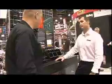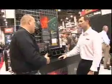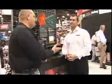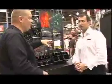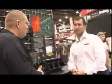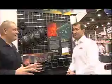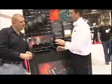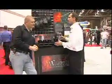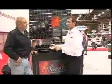You know, a lot of people, I think, when they see the factory intake manifold, it's not that bad of a piece. It's not a bad piece at all. But it has to do things that you might not have to. Noise, vibration, harshness. This is supposed to be a quiet manifold, and it's supposed to fit a variety of applications. So there's a whole bunch of different performance benefits that you can pick up just not having to be a factory level part when it comes to a car being sedate and quiet and mellow. Sure, absolutely. But on that platform, we realised that OEMs are like a 15-minute swap over. So with our manifold, it's a genuine 15-minute swap over from manifold to manifold.